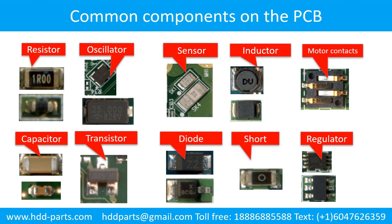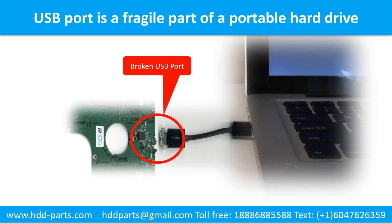This picture shows some regular components on the printed circuit board. Breaking the port connector is very common in portable hard drives, because the connector is soldered on a very thin PCB board — this is the most fragile part of a portable hard drive. One side of the connector is a heavy hard drive relative to the thin PCB board; on the other side is a fixed computer. The connector is like a fragile bridge in between. Every time you use the portable hard drive, you need to plug and unplug it. Sometimes the power connector is broken, but most of the time it's the USB port that is broken, and most likely the broken part is the thin PCB board inside the portable hard drive.